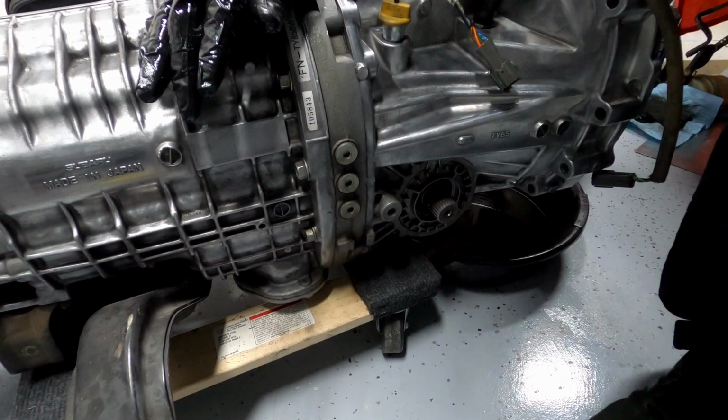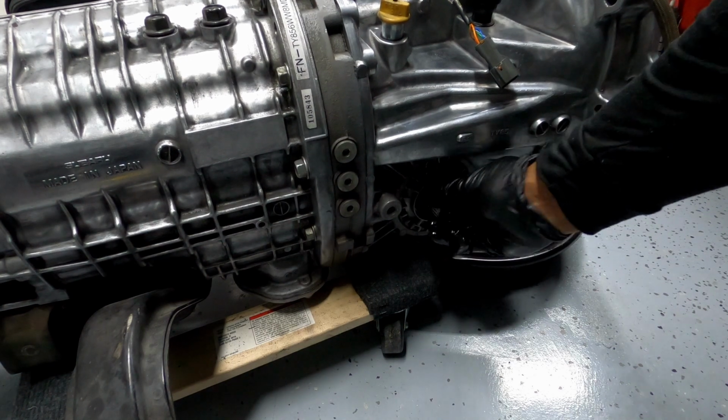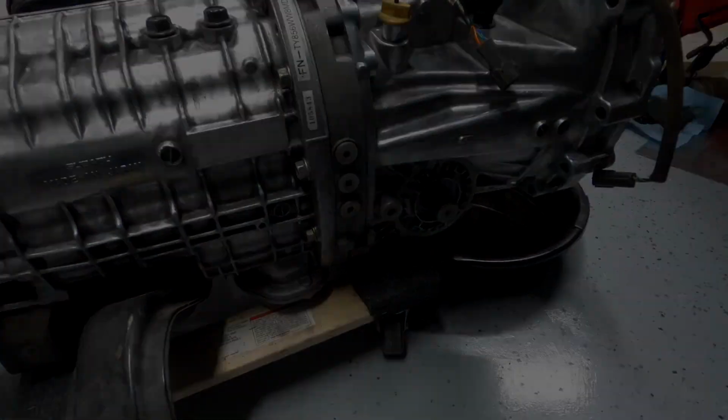It doesn't take much force, and you will hear a very audible click from the circlip when it's fully seated. Once both sides are installed, rotate and tug the axle stubs to confirm proper fitment.